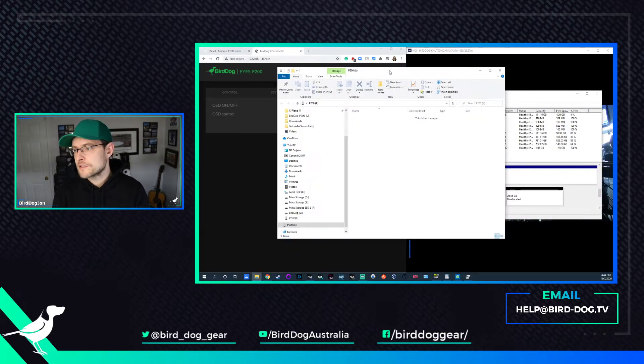The computer is going to create a little 1.95 gigabyte partition and open up the little window for that. There is a download link right below this video on the Knowledge Database for this firmware download. This is called 20.11.3373-nosync. Inside there are two HD20.bin files. These are the baseboard firmware updates because there are two different manufacturing runs for the baseboard from Bolin, so we want to be sure that you update the correct one. If you've already done this and you're in this pickle, you know how to find out what your A number is. If you haven't updated, please don't do anything until we announce that the update is ready. I've downloaded that folder, I know what mine is, and I'm going to drag it over into my new P200 thumb drive.